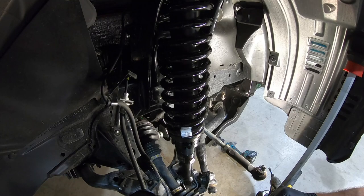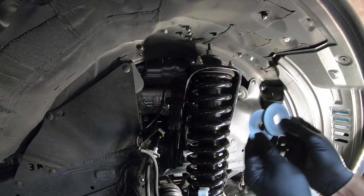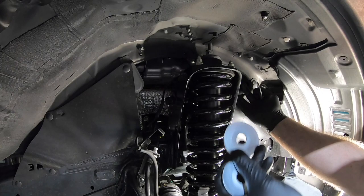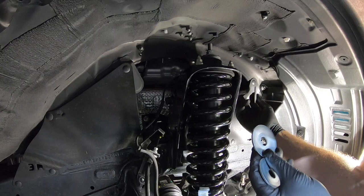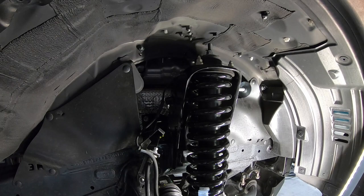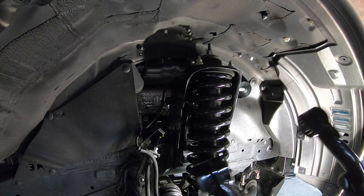Alrighty, now we gotta go get our control arm out of the box. Dobinsons supplies you with new washers. I really don't know what the difference is, but I typically use them, because they come with it. The bolt is still chilling where it was. Use the washer. Make sure you face the washer with the bell out. Also, make sure you grab the correct control arm.